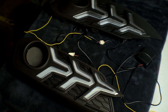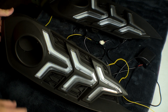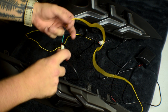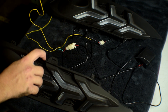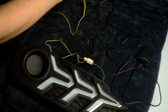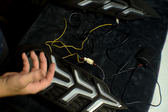I've laid out the aftermarket light so you can see where the fog light goes — you cut out this little piece and put the fog light in. Today we're just focusing on installing this panel piece alone, but we need to understand how it works. You have clips here that provide power, and this connects to your turn signal — so these will be sequential to your turn signal if hooked up correctly. This goes to the positive on the turn signal for both sides, and then you're going to have one really long cord that goes to either the passenger or driver side depending on how you wire it.